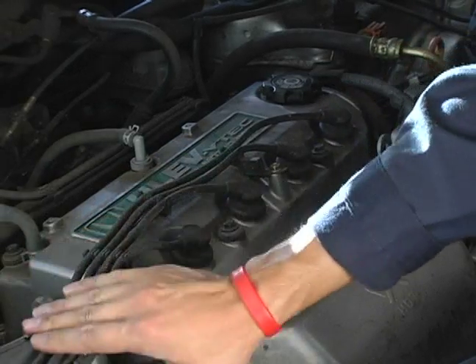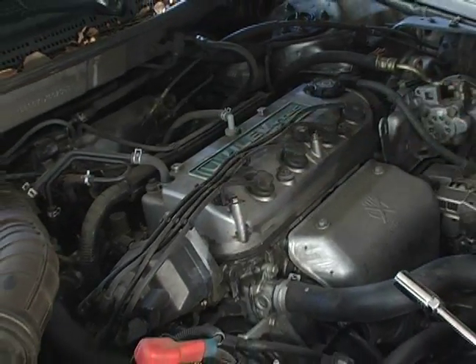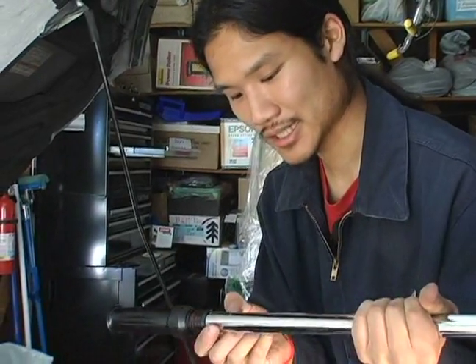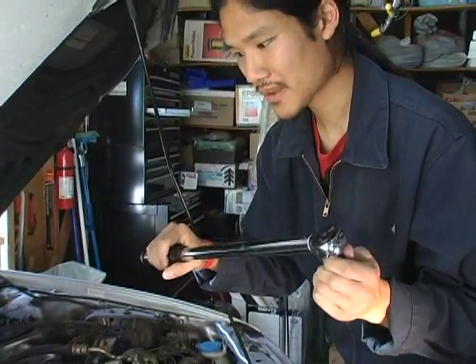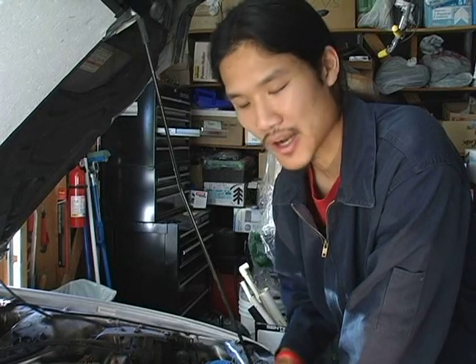Be sure all your wires are nicely aligned and you're done. As a note, when tightening your spark plugs, you may want to use what's called a torque wrench. This wrench has an adjustable amount of force and will actually slip when the amount of force you dialed in is reached, so that when you install your spark plugs, you don't over-tighten them. You can check on the spark plug box for the corresponding torque specification for your vehicle.